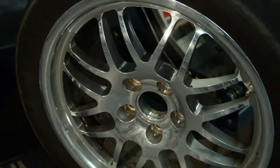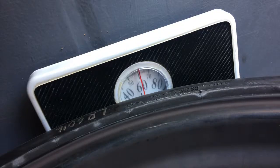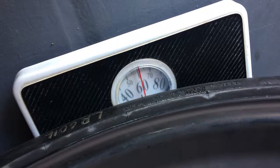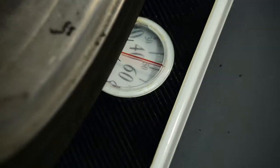The advantage of weight reduction was obvious. The Vossen 087 wheels were 60 pounds — that was wheel and tire combination. When going to the CCW SB16s, I reduced the weight by 11 pounds per wheel, or 49 pounds total wheel and tire combination. The other advantage was getting a 305/30 ZR19 tire for a massive contact patch on the rear end. That certainly improved the grip.